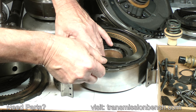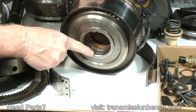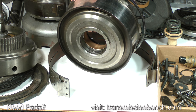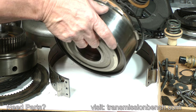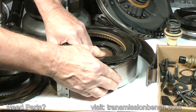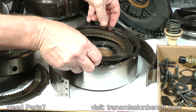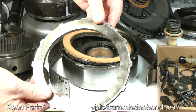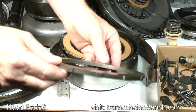Check the inner sealing ring area. If the sealing rings have gouged or cut into this bore, the drum will never fully seal with the rings on the stator support. A replacement drum is available. This clutch pack end plate should be flat — that is item number U22146.